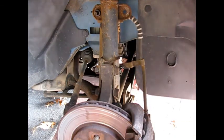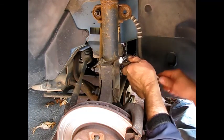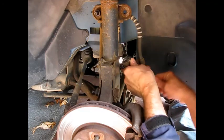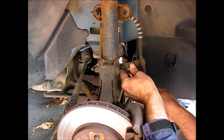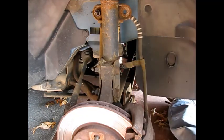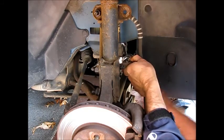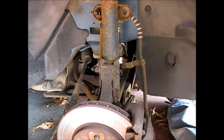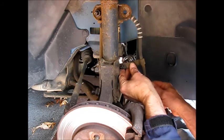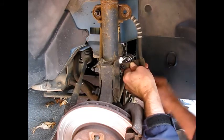Another good practice when removing a fastener like this is to go back and forth — loosen it a bit, turn it a few threads back the other way, and then go back to loosening it again. A lot of times if you don't work it and take your time, you'll break it off, which is often a serious setback requiring you to go shopping for new fasteners. These things have been on here a long, long time — wet, cold, salted, a little rust. Don't expect them to come off instantly.